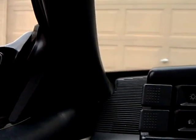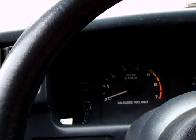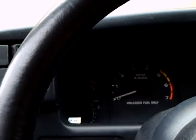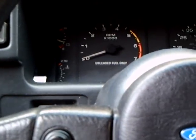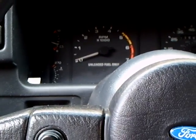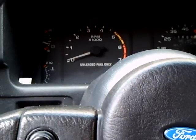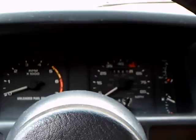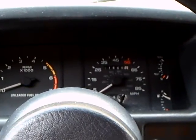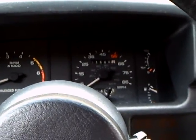Basically the car has been trouble-free, with the exception of a kickdown cable for the transmission. There's a plastic piece on the end of it that evidently deteriorated with time — it clipped off the end of the cable, and the transmission ate itself up within a very few miles. It started slipping. There's a replacement part with a brass end, which solves the problem. And of course I had to get a factory rebuilt transmission. That was a long time ago. The transmission is a four-speed overdrive.